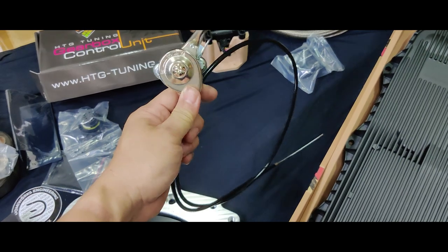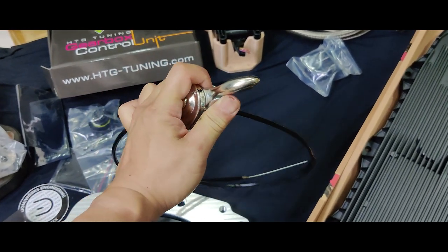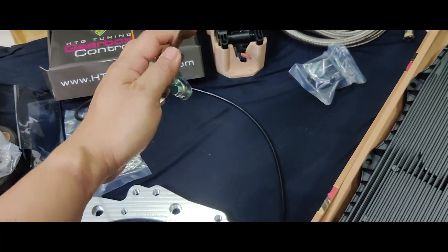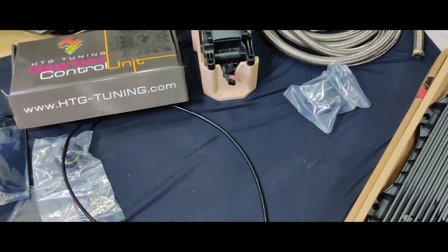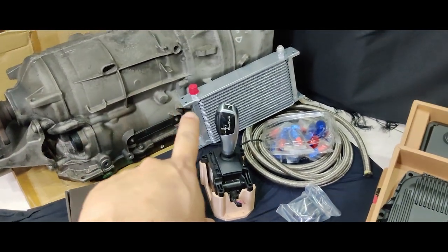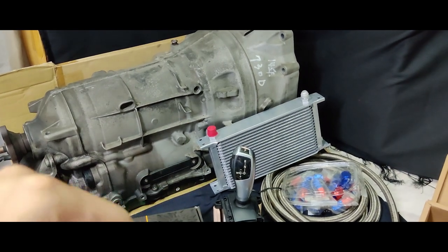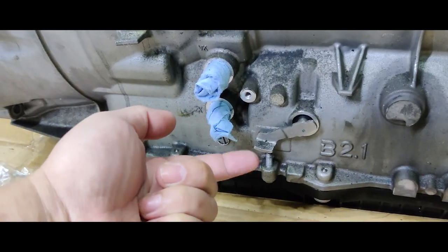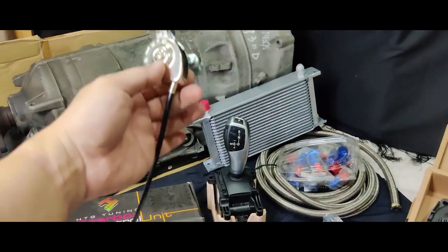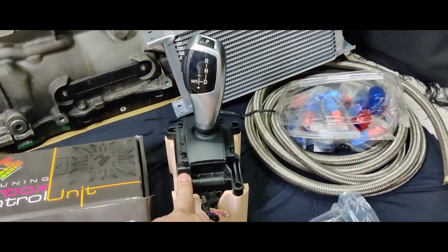This is the neutral release I found — it's actually for farm equipment, basically a cable release with a latch. You slide it over, there's a little lock, and if you need to release it you just press the latch and it releases the cable tension on the 8HP. There is a neutral release on the opposite side of the gearbox — a small spring lever — but to use it you'd have to get under the car. This cable solution allows me to put the vehicle in neutral from the cabin.